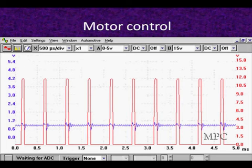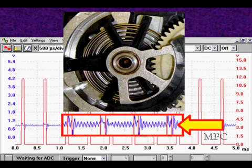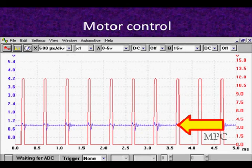Here's what the voltage looks like on the motor and the throttle position sensor voltage. The blue trace is throttle position. The red trace is the voltage supplied to the motor — the duty cycle. In this particular case, it's forcing it open when it's high — it's a high-side switch. That blue trace for throttle position sensor has a little bit of noise because we're constantly working duty cycle against the spring. This is to make the system responsive. It's not going to be the smooth flat line you're used to seeing — it will have some noise. That is normal.